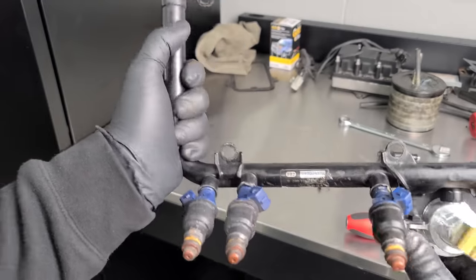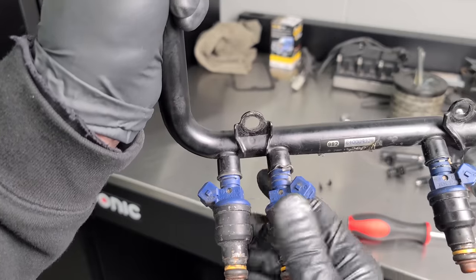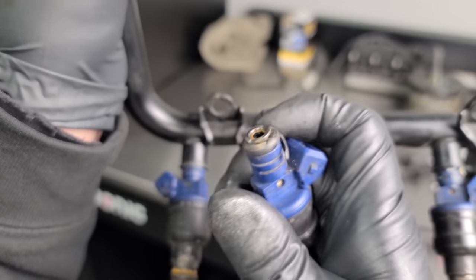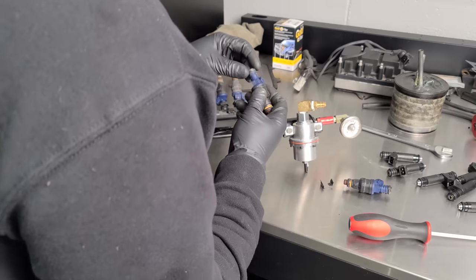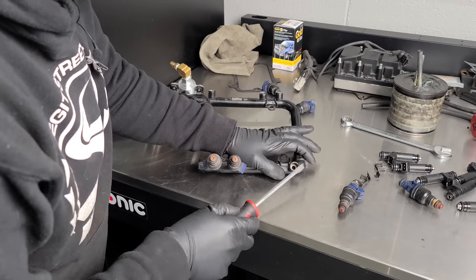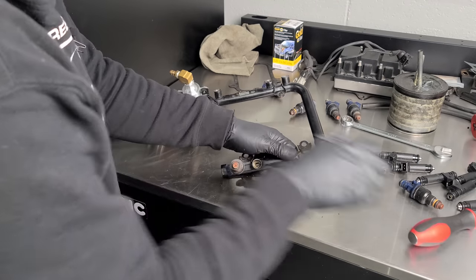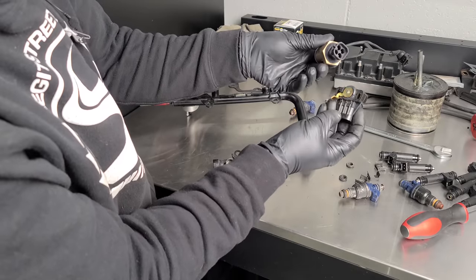Up next are the injectors. I was about to rave about the factory rails — guys are running eights with these rails — but someone mangled mine. Two injectors were missing their retaining clips and the injector seal is all ripped up. This could have been causing an intake vacuum leak as well. The other side has all its clips, which is nice. The old injectors were all functioning properly so we'll save them in our rescue car toolbox. We're also going to replace the idle air control motor and throttle position sensor while we're here.